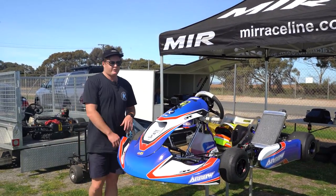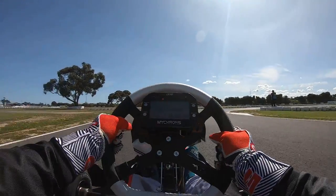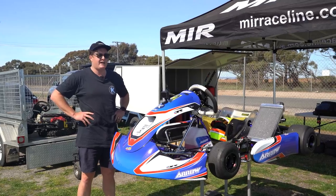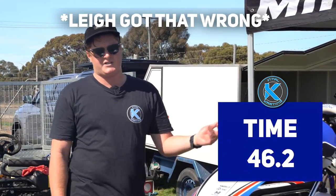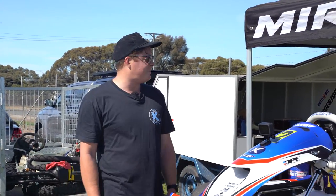Session three: we listened to our mate Jacob Dawson from the Birrell Art team and took the seat stays off. We went a tenth quicker. The car felt a lot different — it was releasing a lot more in the rear and felt very pointy, but it just came off the corner that little bit better, and it kept getting better as the laps went on. My last lap was the quickest at a 46.4. But I think the axle's wrong — being the restricted medium weight at 180 kilos, we've got the standard full-length medium in there. So for the last session I'm going to put the MH — one level harder in the rear — and then we'll wrap up.